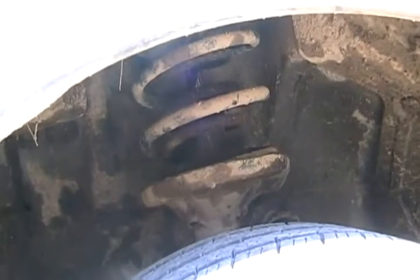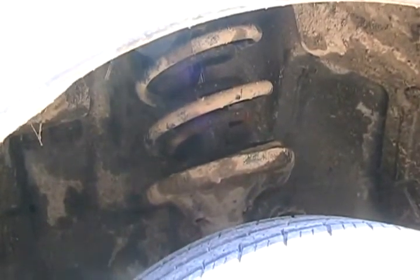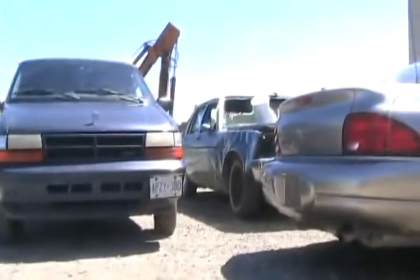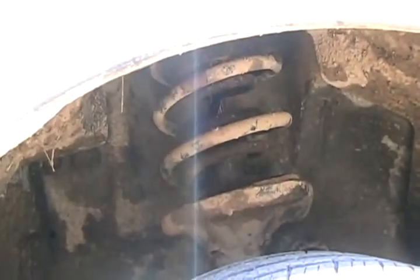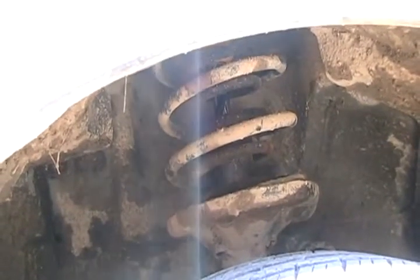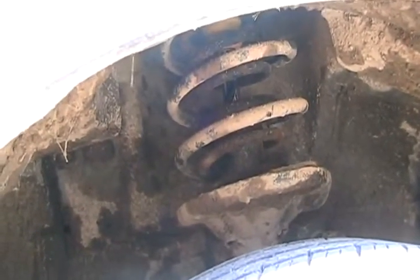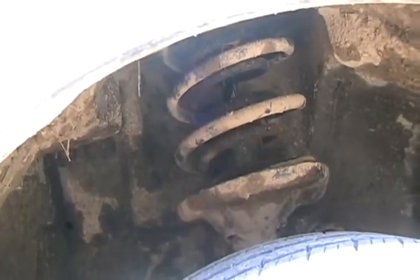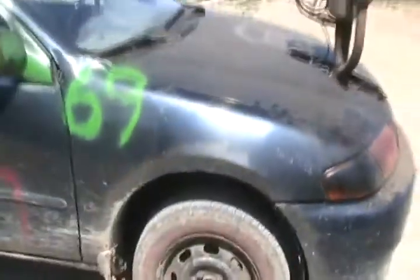Same way I did the redneck roller coaster. If you ever want to modify an off-road vehicle, it doesn't matter whether it's rear drive, front drive, struts, or just single coil springs in the front end like the old Chevy. All you gotta do is get some front or rear springs from another car that are a different diameter, take the struts apart, put them inside, trim them to length and reassemble them.